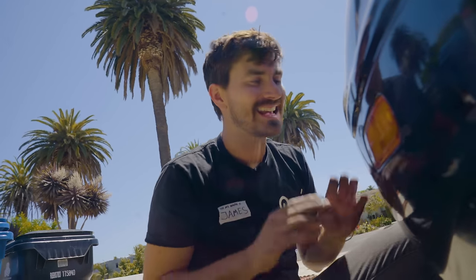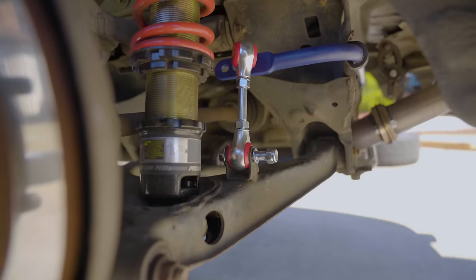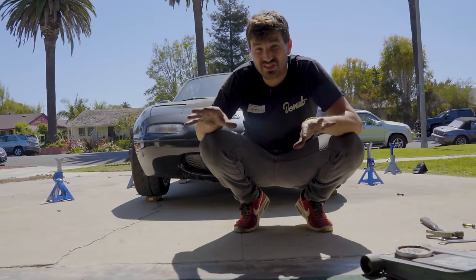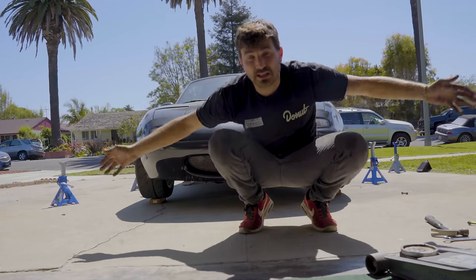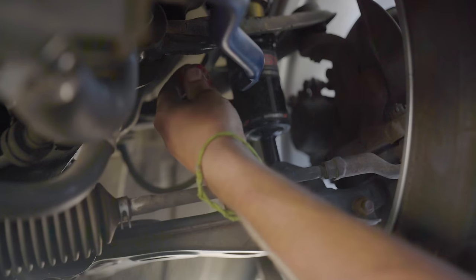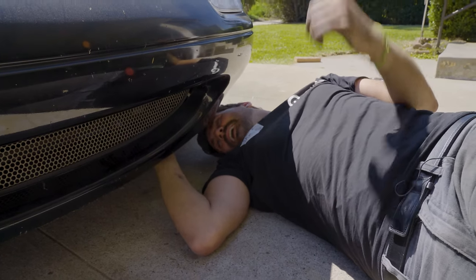You want to make sure when you tighten up your end links that they're not loading your sway bar in either direction. To know that, you have to have the car at ride height with the suspension loaded and everything settled. So we're going to get everything installed about 75% of the way — one end link fully installed and one end link dangling on the sway bar waiting to go into the bracket. We'll get the car on the ground, roll it back and forth to make sure the suspension is all settled, and you can also put your body weight in the driver's seat to simulate what the car will actually be loaded like. Then I'll reach in and adjust the end link until it just falls into line with the hole in the sway bar. Once that's done we can let the roommate get back to work and tighten everything up.